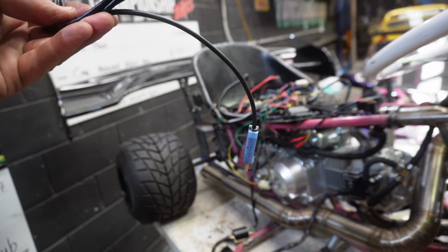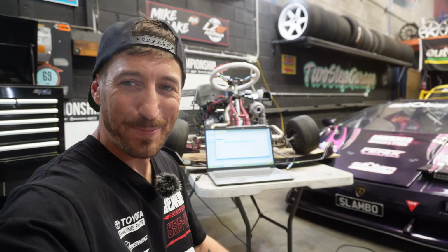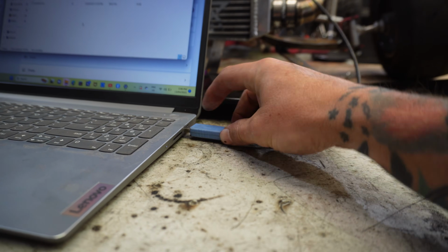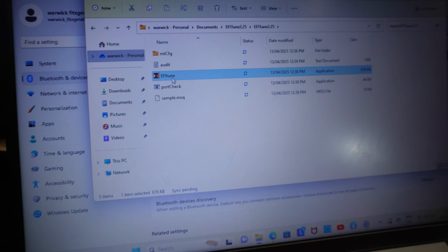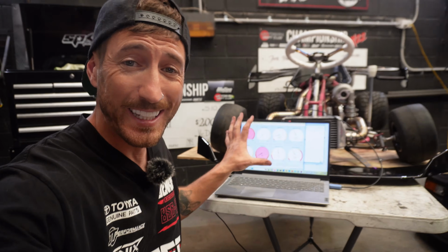So the ECU comes with a USB cable. It plugs in right here, just like that. Then we slide over to our laptop, plug a USB cable into the side of the laptop from our ECU, and we open up our AirFiTune software. Like I said at the start of the video, the links to everything that you need are in the description below, including this software that I put in a Dropbox for you and the tunes that I currently have from our 125cc motor. I will put the new tune from the 150cc motor in the Dropbox as well, just for you.